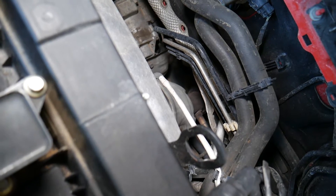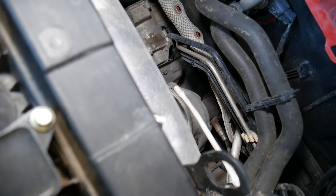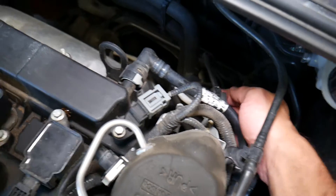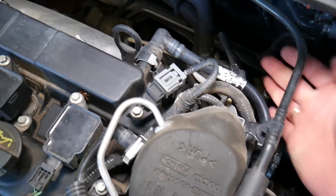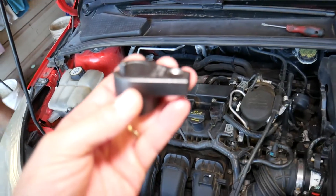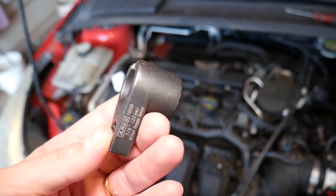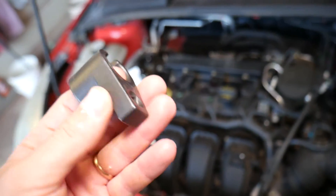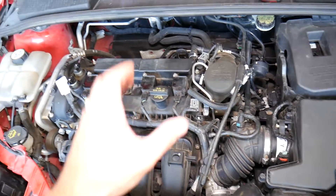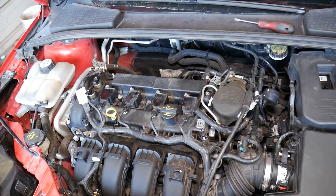This is upstream oxygen sensor one, and this is sensor two — past the catalytic converter. Sensor two detects if the catalytic converter is doing its job, so it can tell if the car is polluting or has a bad catalytic converter. Follow the wire up to the connector and press to disconnect. To remove and replace the oxygen sensor, we use this special socket — we'll have the link in the description below. Without it you can cause quite a bit of damage, so I'd definitely recommend getting one.